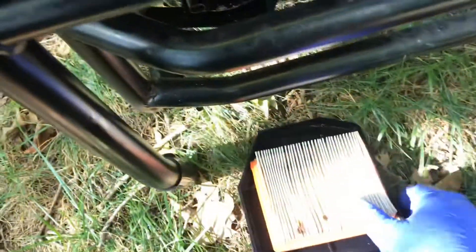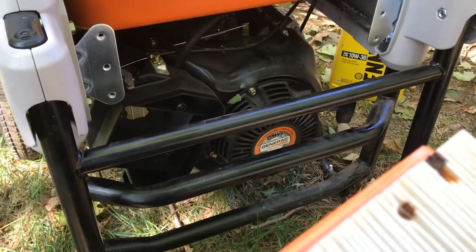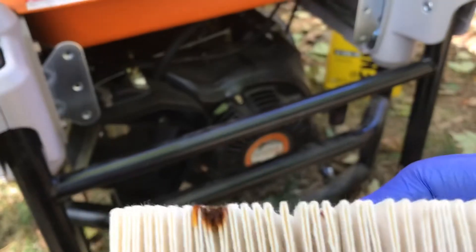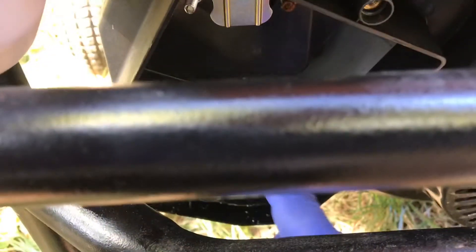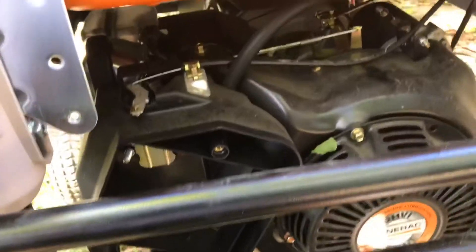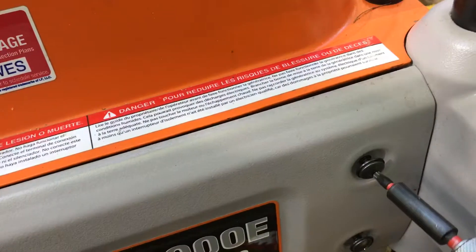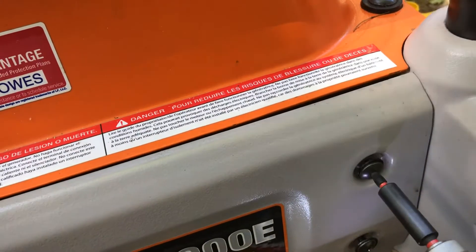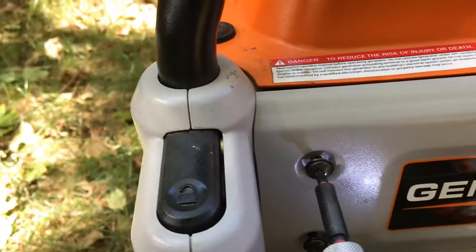Remember: plate first, then the cover. Take a look at this air filter — we've got a couple of burn marks on here; comment below what you think that's from. Everything else looks pretty clean. Get a little rag and clean things out. We're definitely going to change the air filter. Take your new one and insert it the same way the old one came out, then put the plate back on. Go easy — you don't want to strip it.